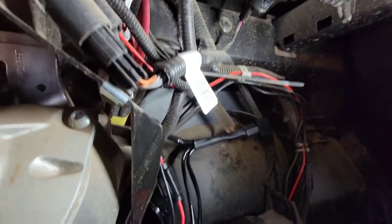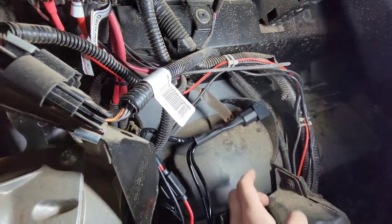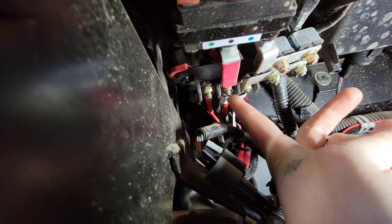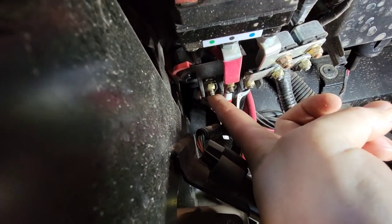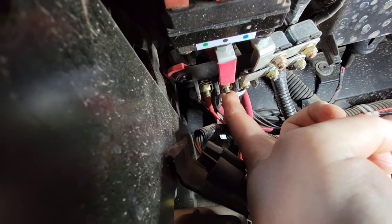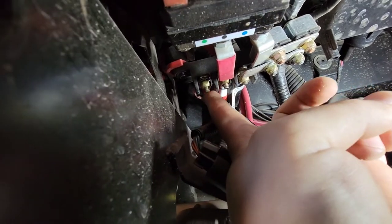Now we're getting into setting up all your wiring. We went ahead and put the relay — there's a screw right here so we just mounted it to that screw. Up here is your bus bar. You're going to put your ground here. This is constant power and this is accessory power. If you want your light bar to only work while your machine is on, hook your power to the accessory. If you want to be able to have your light bar on even when the machine isn't running, hook it to constant power. We're going to go with accessory.